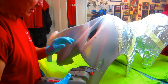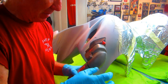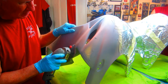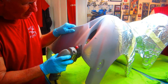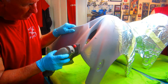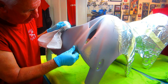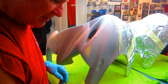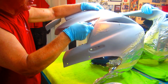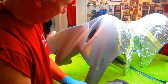So I know the answer is going to take a couple of cycles if I've filled it. I want to sand it flat, then fill anything else. The idea is to use no bondo, or as little bondo as possible. Each time you do it, the little moon craters will get lower and lower — we're sneaking up on it already. It just takes patience at this point, because any time those fibers are exposed, there's always going to be little pinholes and pockmarks that you want to sand out. And that's the beauty of the CA — the CA just does it great.